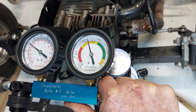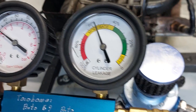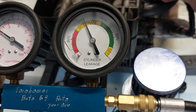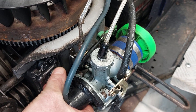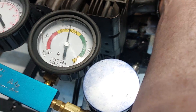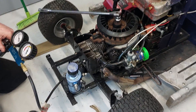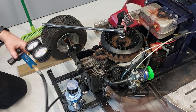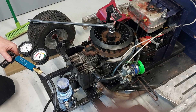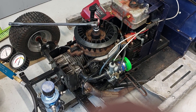If you have a look at where that's sitting now, it's about 60% loss in there. You can actually feel it and hear it coming out of here. You can plug it over — the needle goes up a little bit, and when I release it, it comes out. That's showing me that the rings in this engine are leaking quite a bit past them and allowing the engine to lose compression. I've lost potentially 40% to 50% of the compression on this engine. Even though it goes pretty well, it's not in good condition — I need to do something about this engine.